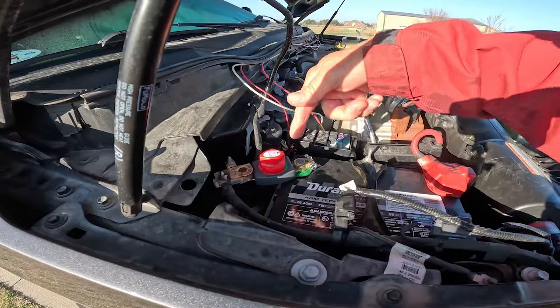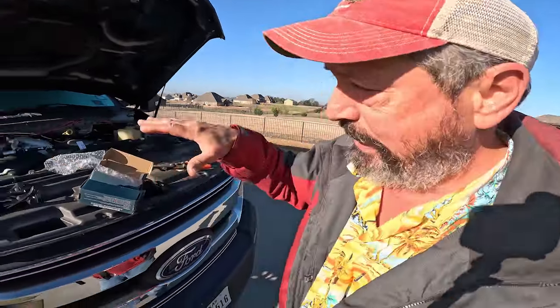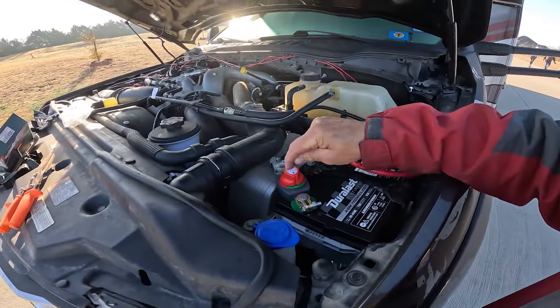With the switch, we have power — and now we have protection. According to the Ford tech, water will get into that fuse box if there's a lot of rain. In my case I drove back from Houston in a monsoon, parked it, then went back a few days later and the battery was dead. So if you're parking your vehicle and you don't want to break out the wrenches, this is a much better alternative for anything with a battery you want to disconnect regularly.